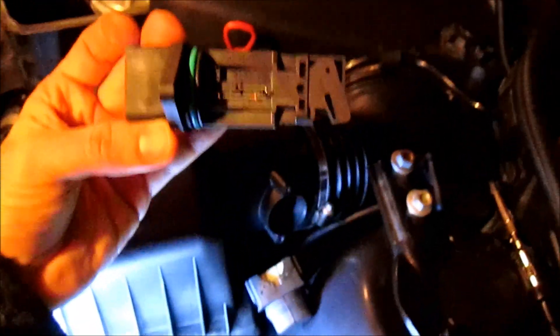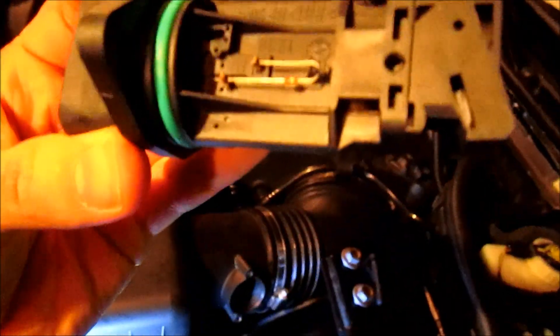To remove the mass airflow sensor piece from the female housing, you're going to push on these two side clips — one there and one there — at the same time and pull apart. Eventually it will disconnect and you can put this aside. Be careful with this; it's an expensive piece and you don't want to damage any of the componentry in case you want to revert back to stock.